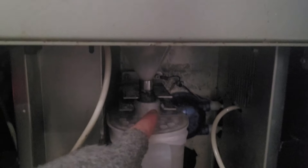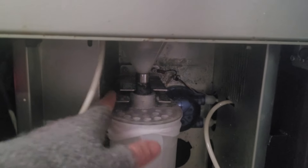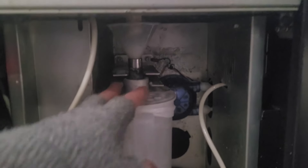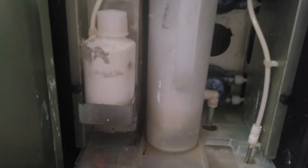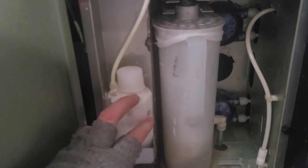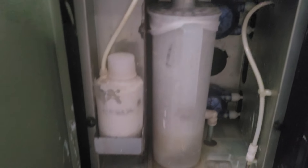The big difference with this machine is the loading system. You can load up to 50 discs and a mechanism lowers down, vacuums the top disc, grabs it, and pulls it into the cleaning chamber. When finished, it lowers down and drops it onto the output spindle. The other major benefit is the built-in filtration: when it's finished with the water, it drops into a filter unit that uses electricity to filter out the compound. Clean water comes out to be reused and pumped back up. That type of bottle in the other machine would last me about a month — on this one it lasts much longer, I don't remember the last time I changed it.